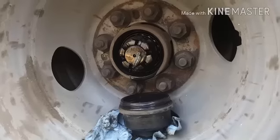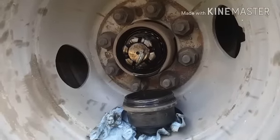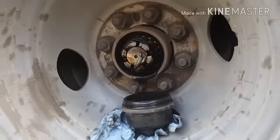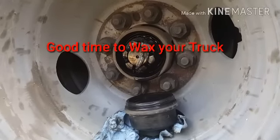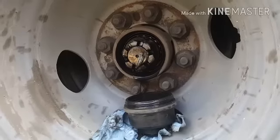Another thing — your lights and connectors. Go back, disconnect them, get you some electrical grease and put a little dab of fresh electrical grease in them, push them back in. Because if you're traveling in that snow, salty weather, and rain, eventually that connection corrodes. But if you got some electrical grease, it'll make it go a lot longer.